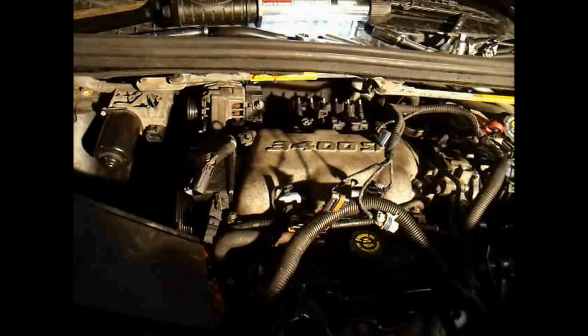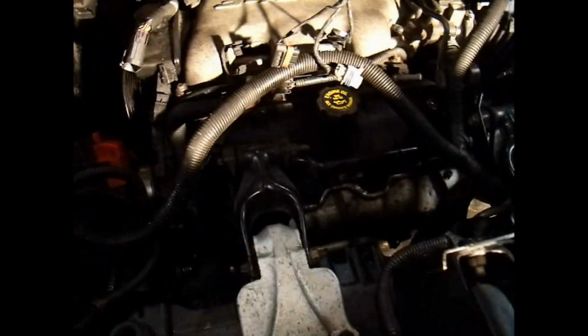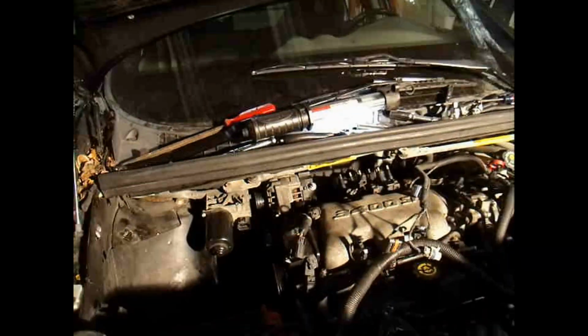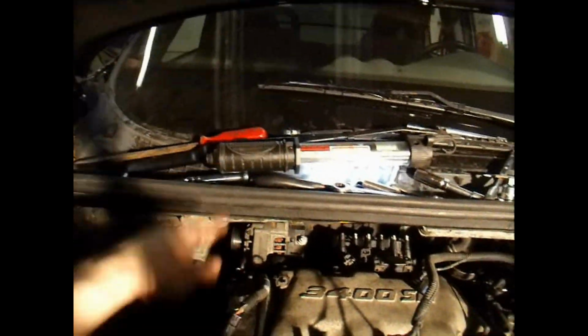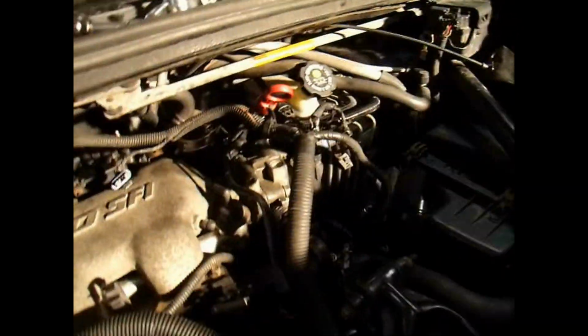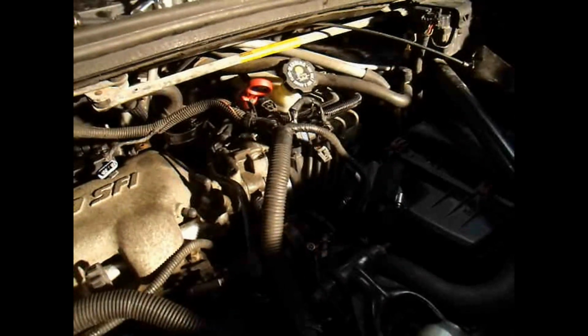Alright, next day I'm back out here in the garage, and I went ahead and put in the spark plugs here in the front. I've got it jacked up here to put in the back spark plugs. Then I'll run the spark plug wires, then I'll hook up the alternator. I've got all these wires yet to connect, so really not much left to do other than a few fastening things together. Got to put the windshield washer reservoir in here, the overflow tank there, and the throttle bracket on there as well. So it might sound like a lot, but it's really not.